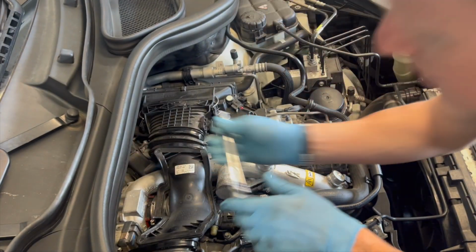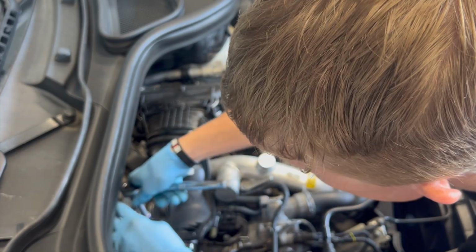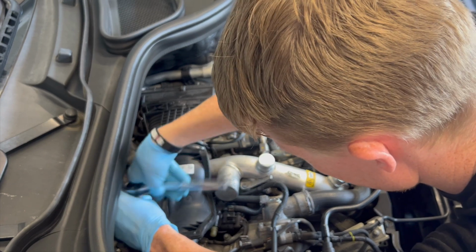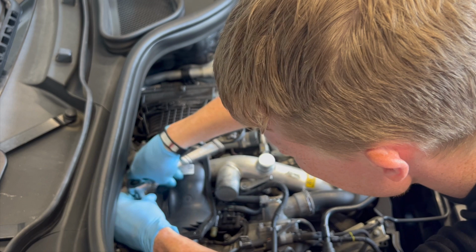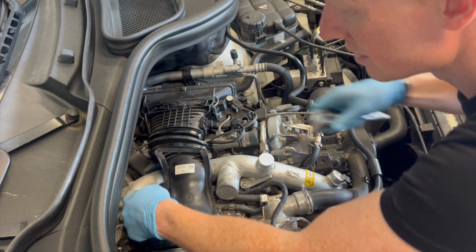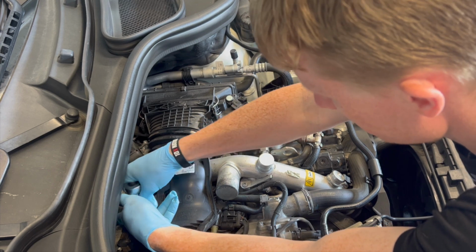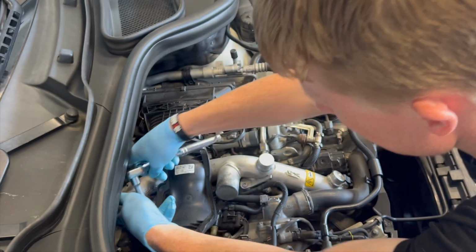Yep, cool. We can get that on. We just need a shorter head, shorter extension to loosen that up. Down here, it comes off real nice and easy. It doesn't have to be super loose, but definitely loose enough so it can be pulled over the snout of the turbocharger. A little more like that,